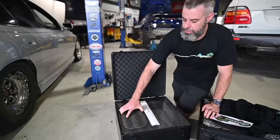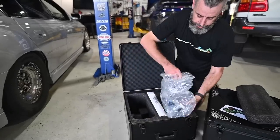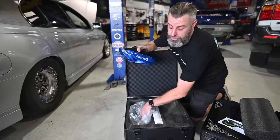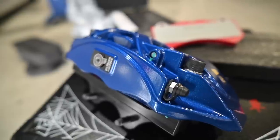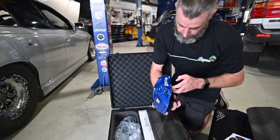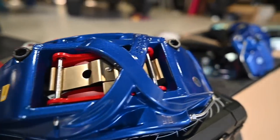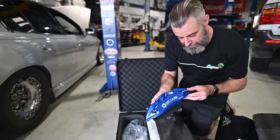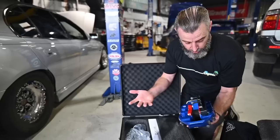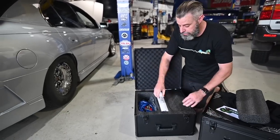Let's check out the rear caliper. I don't even think I took these out of the plastic - I've had these for two weeks, sorry Diecase. The front calipers are six-piston calipers paired with a 380mm rotor. The rear is a four-piston caliper, again monoblock, going on a 355mm rotor. The paint's quite nice, stainless steel pins, anti-rattle clips, and they've done the same masking. There's also rubber protection at the bottom. They have stepped the quality up - it's like they're learning, who would have thought. It's quite heavy.